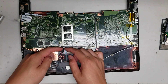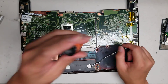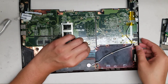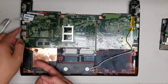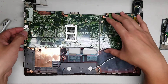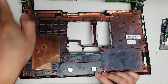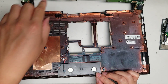You do want to disconnect the speaker — grab the wings and wiggle it. After removing all the screws, the headphone jacks stick out so you do have to lift from this side first and undo the adhesive. Once you lift that up, slide this to the side to get the headphone jacks out. Now we can see the bottom of the motherboard. There's not really much you can do except redo the thermal paste — everything else is built into this board.